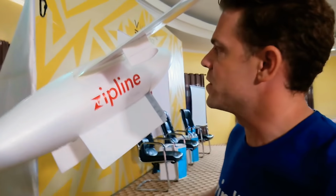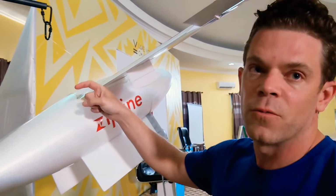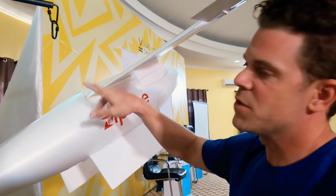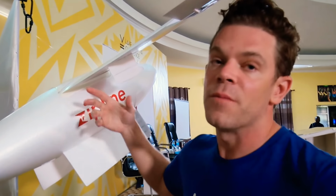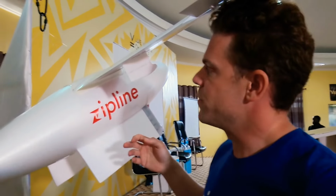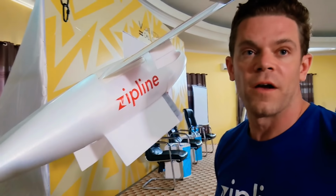The other thing that you may notice that's different from our previous aircraft is before we had 2 propellers and they were right behind the trailing edge of the wings. And so, there's 2 different speeds of air coming over those wings, hitting those propellers, and so the propellers in the turbulent air make a really loud whine. And also, there's nothing blocking, so you hear it on the ground a lot more.